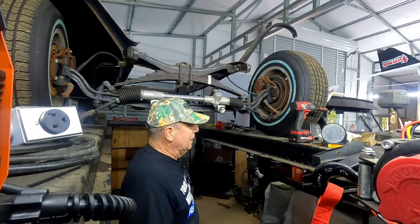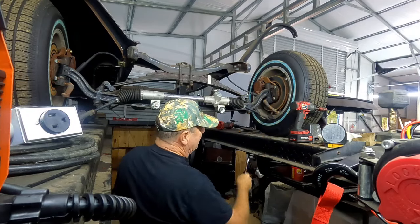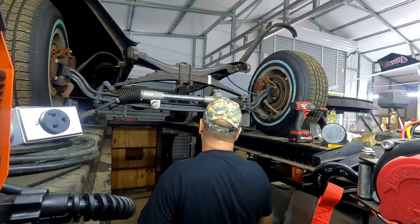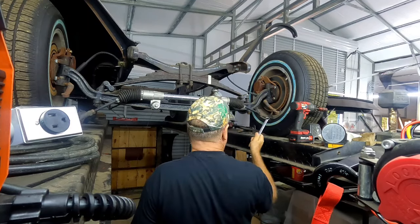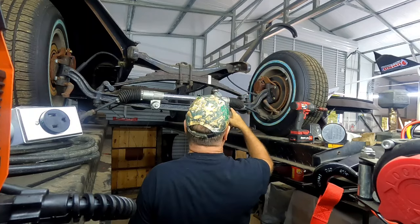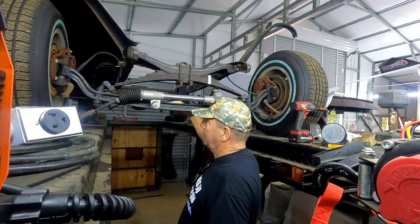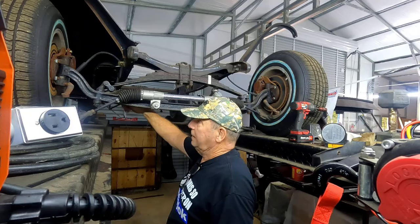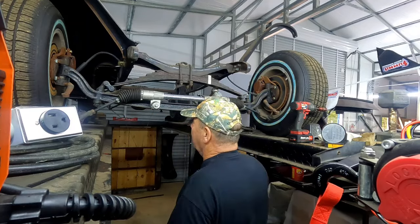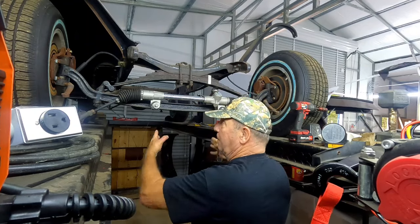Now, these are forged steel, so I can deal with that. Here's the way it's supposed to be. This spindle is supposed to be on this side of the car. That spindle over here, they're supposed to be behind it, so that with a steering box it would have the drag link going across, hooking to this side, then with a tie rod going across between the two. It makes it safer - you wouldn't hit the axle first, you wouldn't hit your steering.